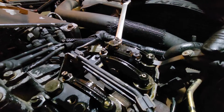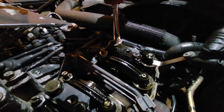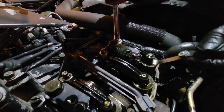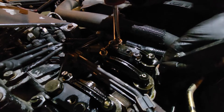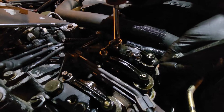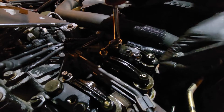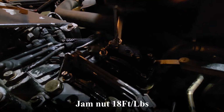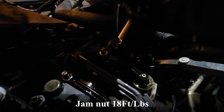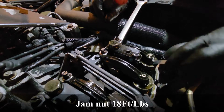So adjust the intake side first, try it out. If the feeler gauge feels loose, try an 11. If 11 fits, tighten up some more. Move to the exhaust side, same thing with 20 thou. If 21 fits, tighten it up some more. Feeler gauges are super accurate, it's amazing. So just go back and forth till you get the hang of it. Counter hold and snug it down. Torque spec on that is not a lot.